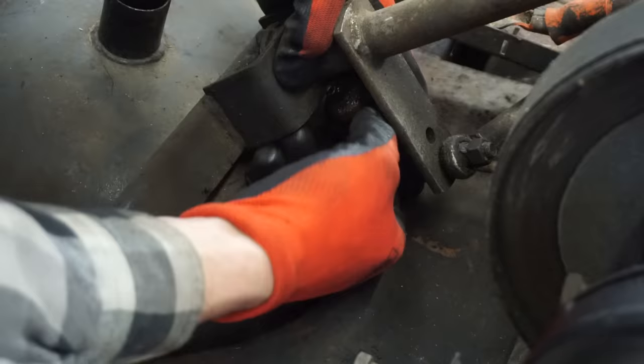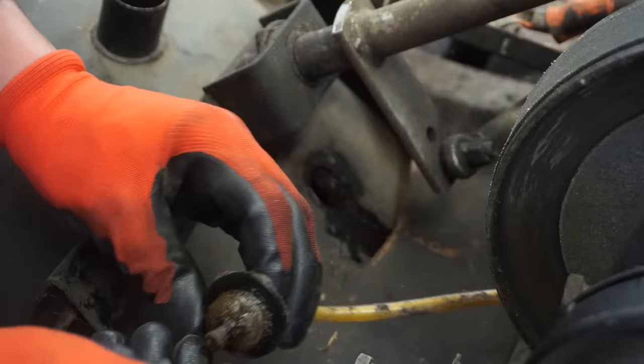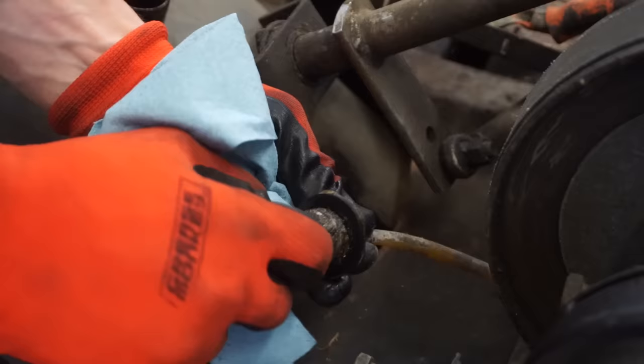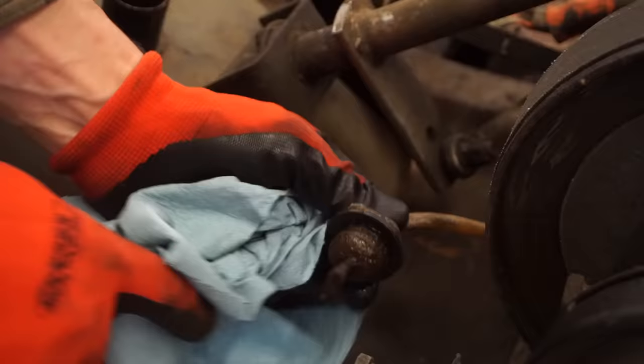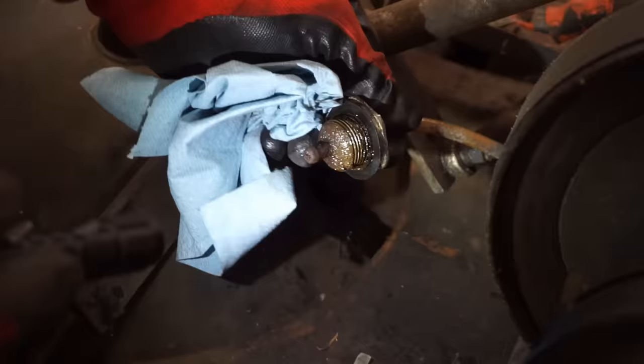She's a little rough. Yeah, there's no way that would be getting anything through there. I'm curious to see where the bottom of the tank is. A tiny line coming down from it. But it does have a nipple, so it must have lost a line going down into the tank. You know? Because this is supposed to have a line going down further into the tank, and that was gone. So I wonder if that was why it lost fuel.